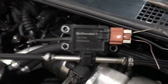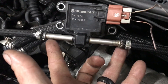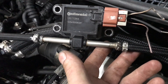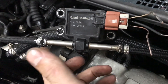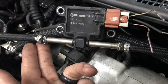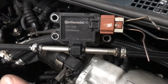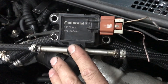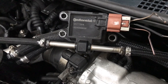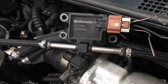I went and bought 3/8 crimpers from Home Depot — I use these on PEX tubing for plumbing. Because the return line is not a high pressure line, these should be just fine. I put them over my 6 AN return line and just crimped them right down. You can do similarly, or — not recommending hose clamps — but you can use hose clamps, compression fittings for AN lines, or even regular hard fuel lines.